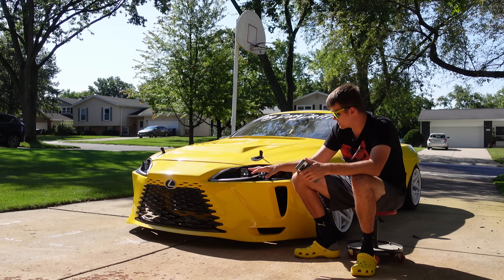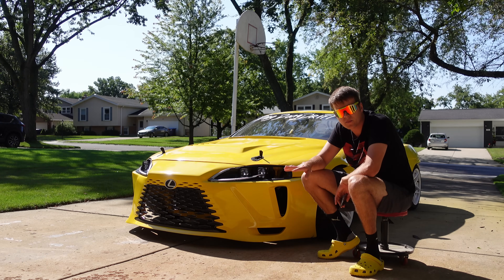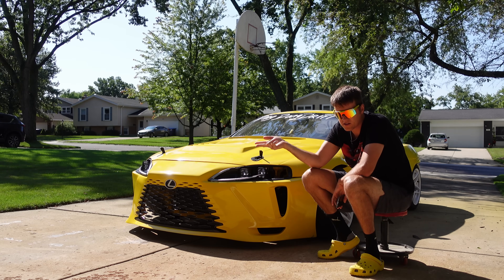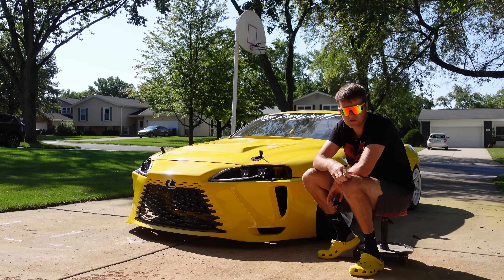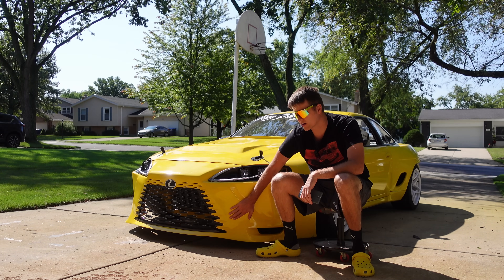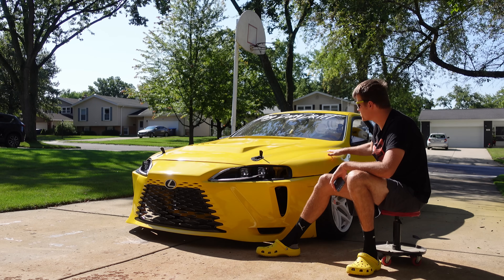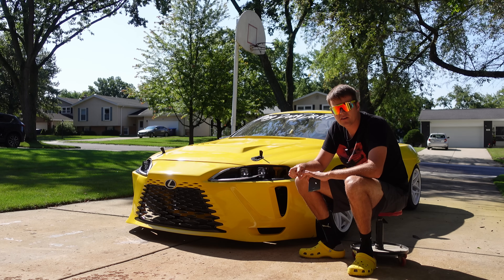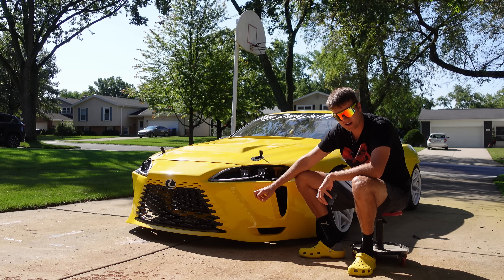What filament did I use? This is all PETG. I always get messages asking how to make PLA last in the sun — just forget PLA, throw it away. If you want to do car stuff, PLA will never work. PETG, ABS, and ASA are the three main ones. PETG is the easiest to print but has the lowest glass transition temperature, which is why I put fiberglass on flat areas facing the sun. The entire wide body is fiberglass because it's huge and facing the sun — you have to make sure it doesn't melt.